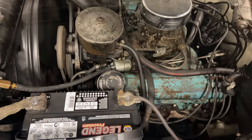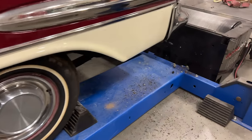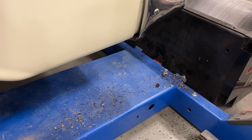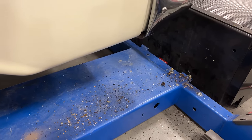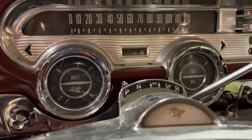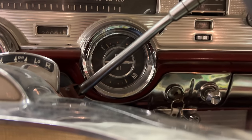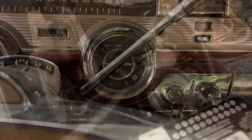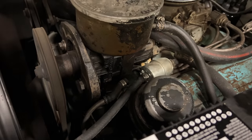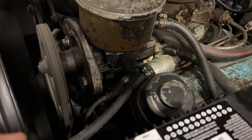It's running — you can see it's blowing all kinds of mouse nests out of the exhaust right now. It smells absolutely terrible. Inside the car, if I rev it up, you can see the charging system is working. And over here we have almost 60 pounds of oil pressure, so that looks good. Up here in the engine bay, we have no signs of fuel coming from the fuel pump, so if we want this car to drive, we're going to have to address that problem.